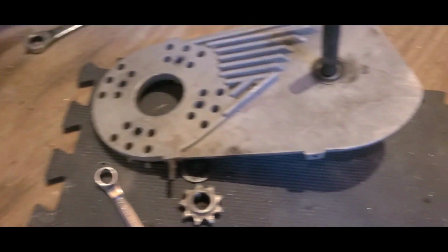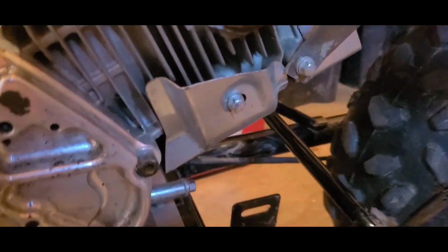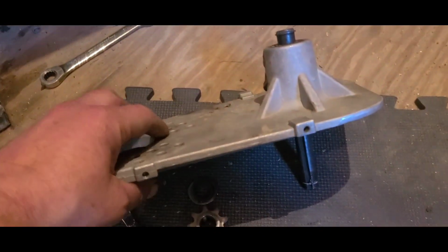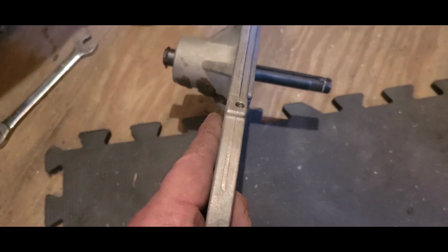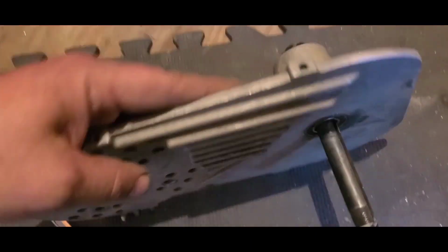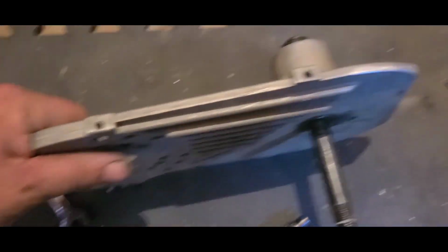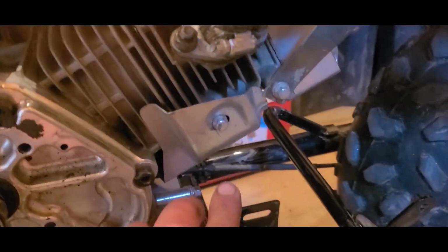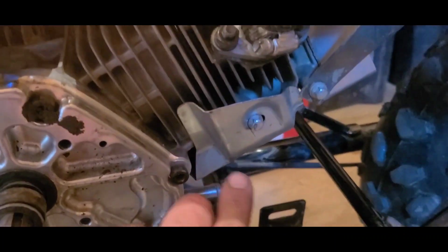What a mess. A little bit further into my investigation, and this is what I find. This bolt was making contact with this torque converter plate right there. I didn't notice it before. And I'm not sure if we tweaked this thing. And it's cast aluminum. I'm gonna remove this bolt. I'm just gonna get it right out of the situation.